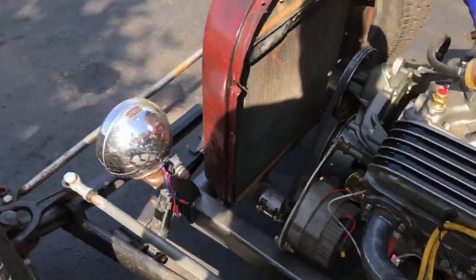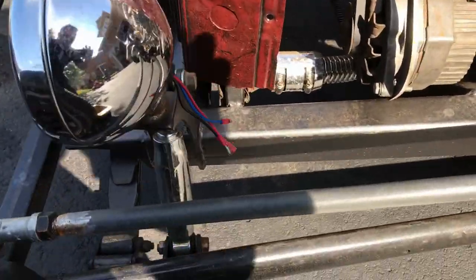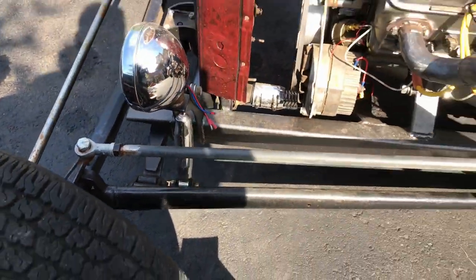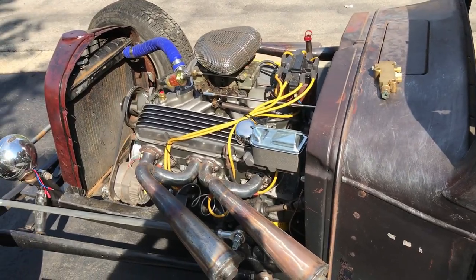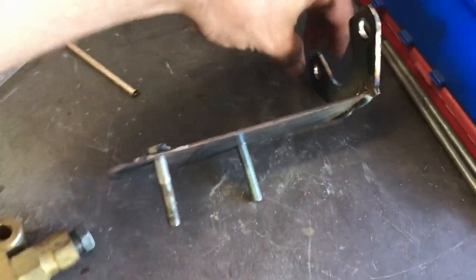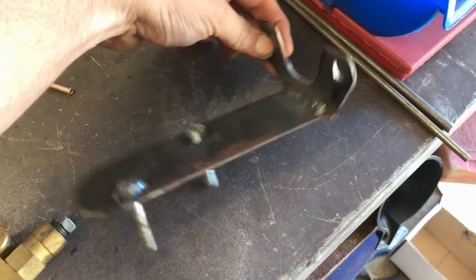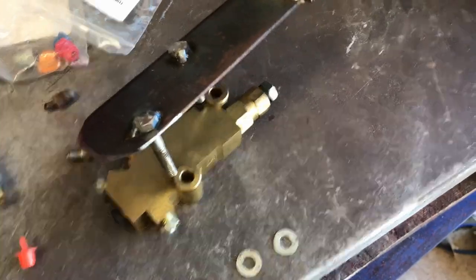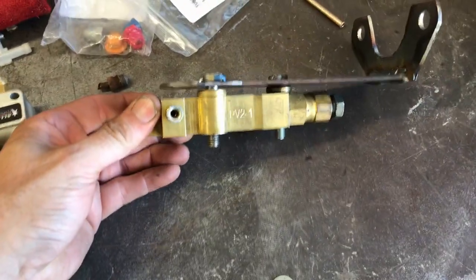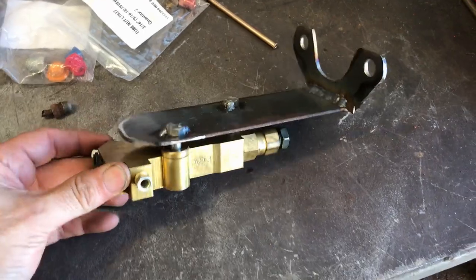And after that, install the big meaty calipers in the front. I'll need to weld the little tabs onto — I've no idea where — but for the flex pipes probably around a bit here. They're going to have to be quite long; I hope I've got the right ones. And then plumb the lines in, fill it with fluid — Bob's your auntie! This will be my little combination valve bracket that will get bolted up through the same bolts as the master cylinder, so it'll sit just underneath the master, and then the combination valve will bolt up. Once that's all bolted tight, I can start actually flaring pipes and screwing them on.